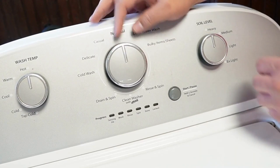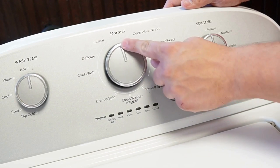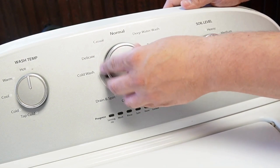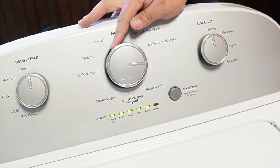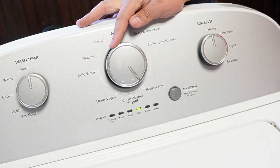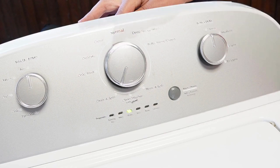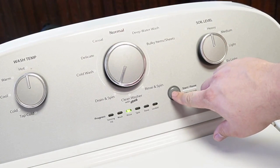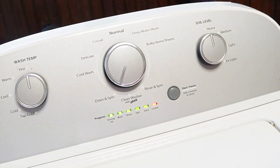It should be pointed at this point at 3 o'clock or all the way to the right position. You need to do all these things within three seconds and it may take a few attempts, but if you've done this right, all the lights at the bottom of the washing machine control should flash on and off, showing that you've entered into the diagnostic mode. Once you're in this mode, you want to turn the knob clockwise four times. The rinse light should be the only one illuminated solidly by itself — this is the recalibration mode. Once you press the start button on the rinse mode, the door lid will lock and it will begin a series of tests and operations on your washing machine.